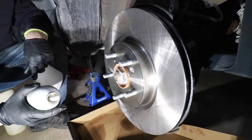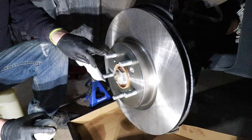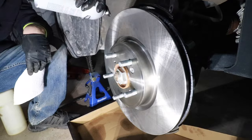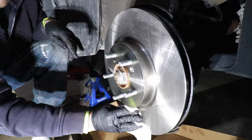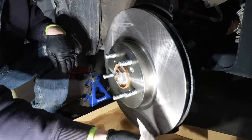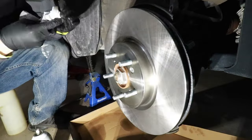That is tight. With the new rotor installed, we're going to take some brake parts cleaner or starting fluid. There's a protective layer of grease that this rotor is shipped in, so we're just going to spray this down — try and get the backside too. You really should do this with the rotor off the car, but just for video's sake. Just try and get that oil off there, which it will burn off relatively quick, but it's best to try and get as much off now as you can.